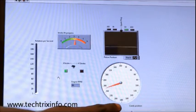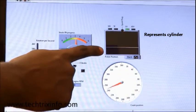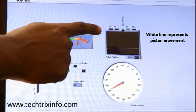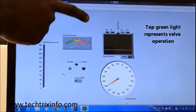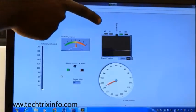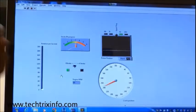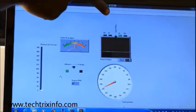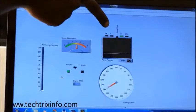I am pointing towards the clock which represents the crankshaft, and now I point towards the cylinder representation and the piston movement. The white line moving represents the movement of the piston, and above that you can see green lights glowing. In 6-stroke mode we have 4 valves, and in 4-stroke mode we have 2 valves. That glow of the green light at the top shows the valve movement. Currently we are running in 6-stroke mode. In the center top you can see the spark plug also glowing at the power stroke point of time.